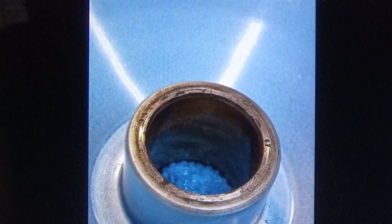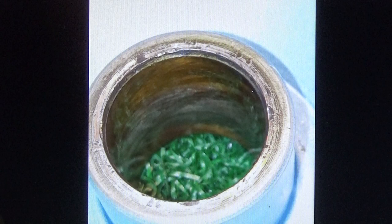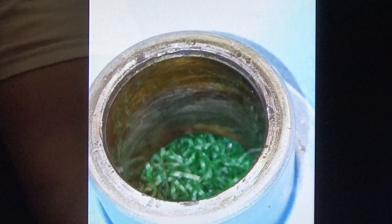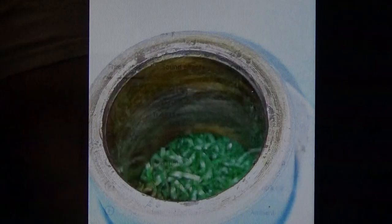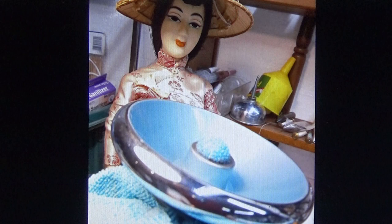Here again, we're looking at more rust. This is part of the balance wheel. Combination of varnishing and rust. Inside as well, see that? It's all rust. And this is again just the type of metal that they use to manufacture the machines has this greater propensity for rusting. Systematically getting that off the machine. And again, it's a combination of working it off and then also conditioning that metal so that the rust is not going to return.